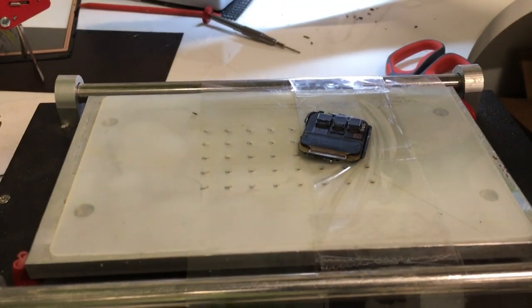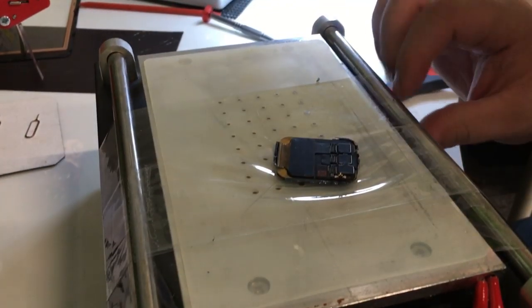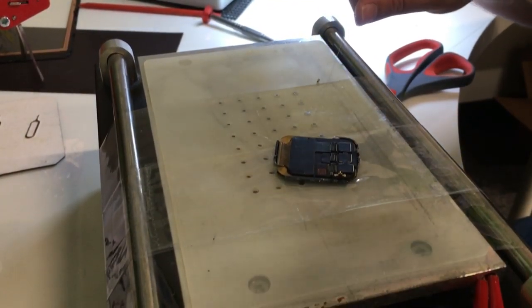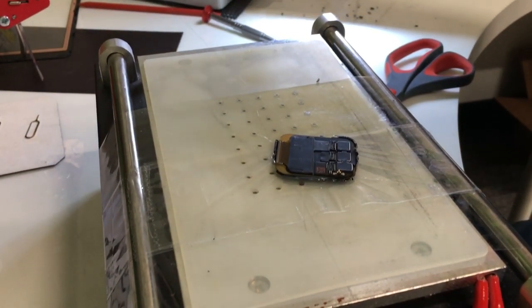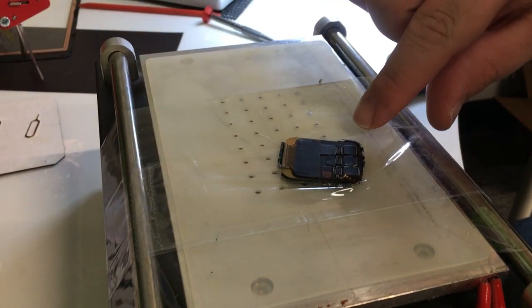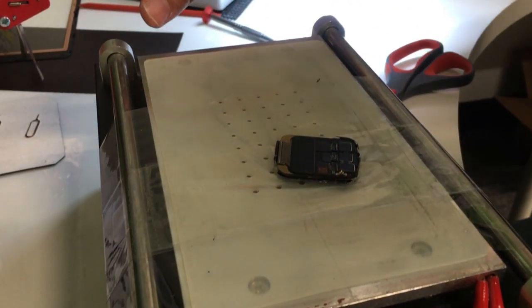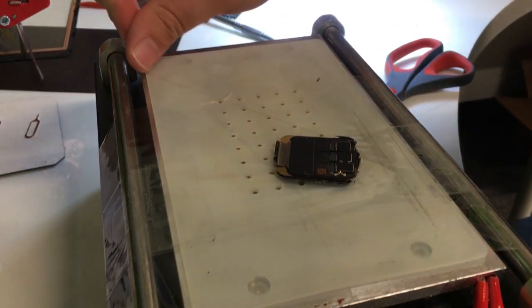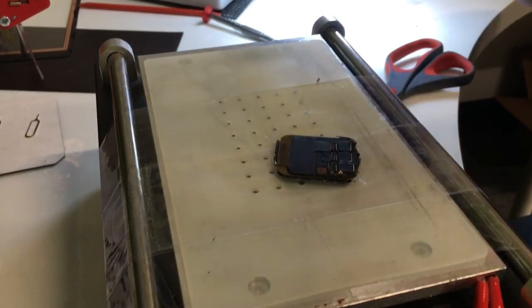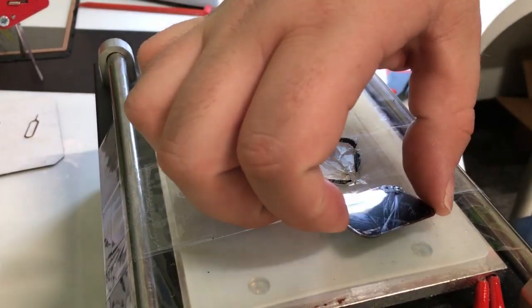It's important and imperative that you understand how much give and take you can have on each one of these wires. And then I also position the heat plate to accommodate the ways that I'm pulling on either side of the wire, whether or not I'm pulling with my right hand or my left hand, and I'm able to guide the wire around because I don't want to damage the display or the digitizer in the process. And the wire being so thin, it is necessary first to cut through, but also can cut through those layers and ruin the display if not done properly.